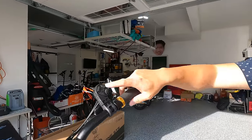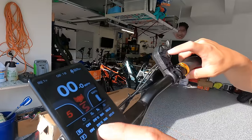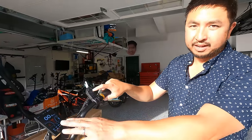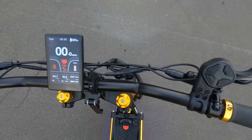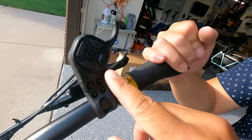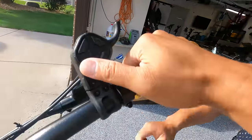Okay, got it all set up — let's do a walkthrough from top to bottom. Starting with the right side, we have the trigger throttle and a four-button control panel. You use the mode button to go through the different settings. You can see the current going to the motors — front and rear — as well as the temperature, which is a nice added touch. When you're riding fast and hard especially in hot weather, you should pay attention to motor temperature. The display is really sharp and crisp, and even standing in direct sunlight you can see all the information clearly. The buttons are slightly angled but at a perfect angle for your fingers when your hand is in riding position.